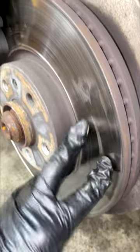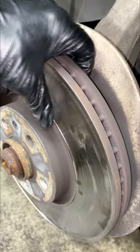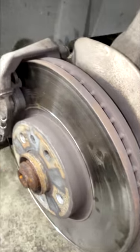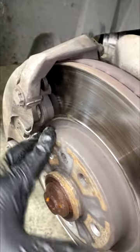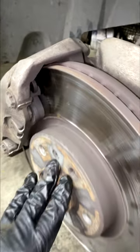When you keep doing that, this rotor will just continue to sink in. You see the lip on this rotor? At this point it's time to replace it — there's a bigger lip on the inside too. All you're doing is ruining the center portion of this rotor. This rotor will likely fail the measurement test right now, because people have simply been constantly replacing pads — pad slapping.